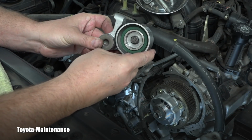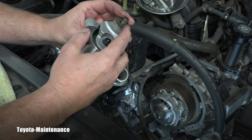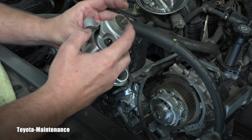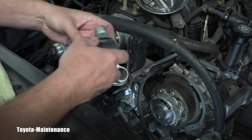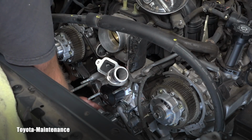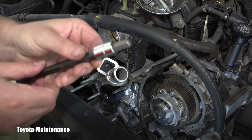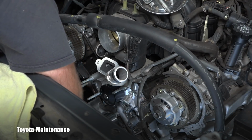Here you can see number 1 idler pulley, which is the tensioner, right? The hydraulic tensioner part. Don't forget about the spacer, right? It needs to be there. So I can start installing that in its place. You are using that 10mm hex. This is the hex tool, right? And you are nicely, carefully screwing it in.